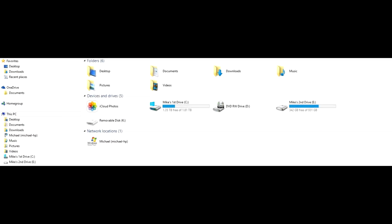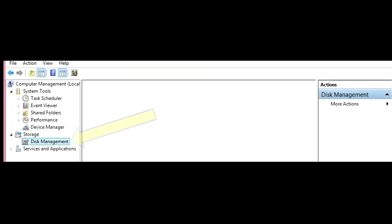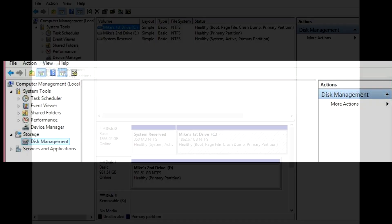Now let's say you just installed the drive and it won't show up on your screen. You can hear the drive, and by putting your hand on it you can feel it working. Go to My Computer on Windows 7 and XP — mine is Windows 8. Then click the Manage button and click on Disk Management. It may take a minute to find all the drives.